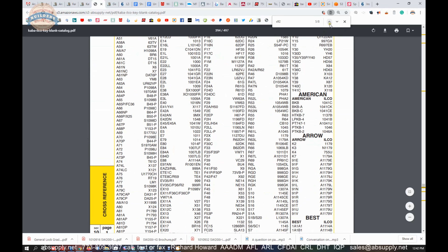We have an ILCO column for the X92, and they are saying that the F42 and F45 from ALBA — whoever that is, I've never heard of them — would be a cross reference, along with the Briggs and Stratton key blank numbers 321 and 233. And then Dominion has a cross reference as well. Silca also has a version — their NE42. The point is, if you are looking at a key blank regardless of who the manufacturer is — Silca, Jet, Taylor, Dominion, etc. — you can fire up the key blank catalog and do a find function to come up with a cross reference. If you know you have a Silca NE42 and just want to know the Kaba Ilco number, it is X92. It's in the catalog, and that is why that is so important.